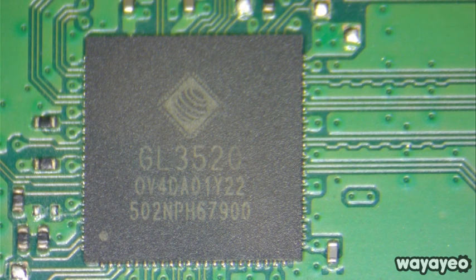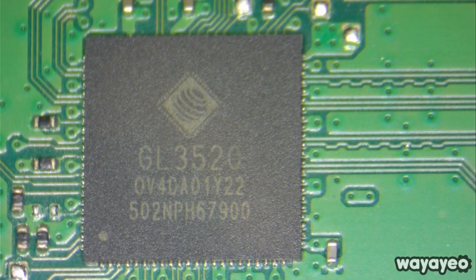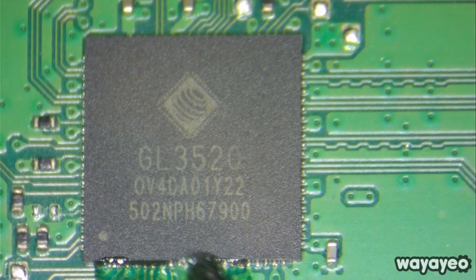This PlayStation didn't work with the USBs, and the reason is probably the chip that controls the USB. I used the Bluetooth chip before and that usually fixes the issues, but we tested it in safe mode and in regular mode and still no go. That leads me to believe this GL3520 is the issue. We're going to go ahead and replace it — I'll put in the description whether everything worked well and we'll see how it goes.